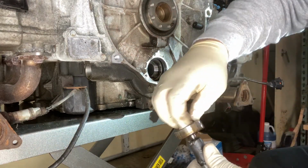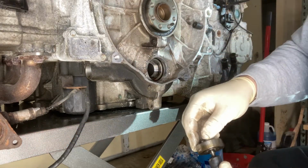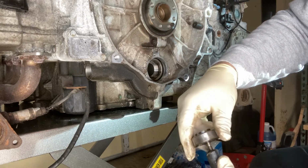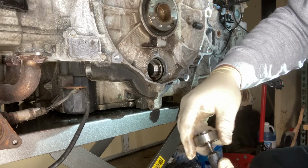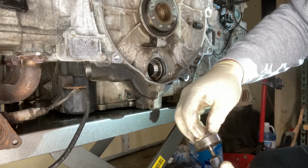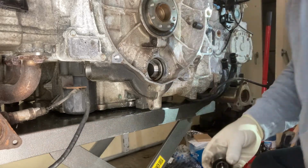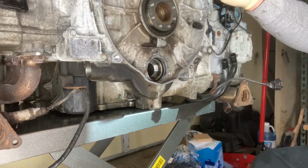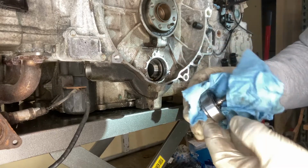Try to get this threaded off of the tool. Again, you have reasonable expectation that some oil is going to flow out of the shaft as it remained in there, even when you drain your oil out. And what we have here is a single row bearing, the problem bearing, if you will, that Porsche has designed into this.